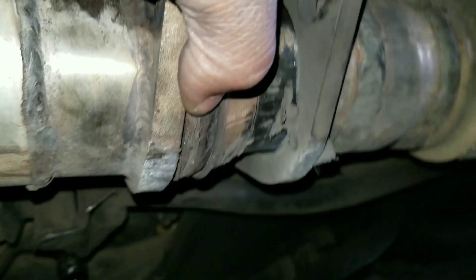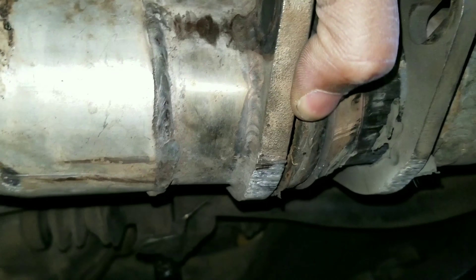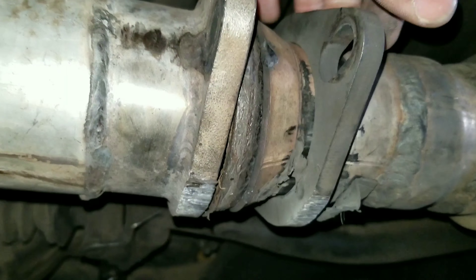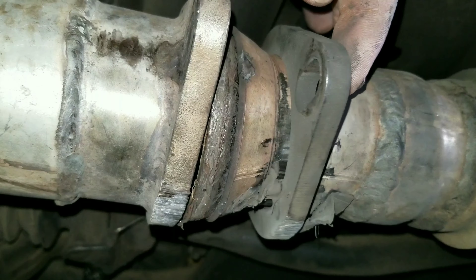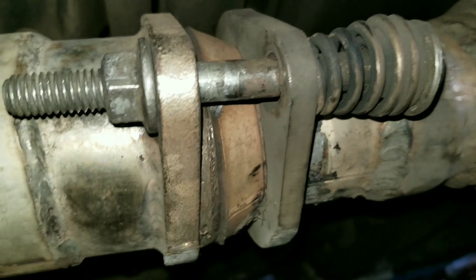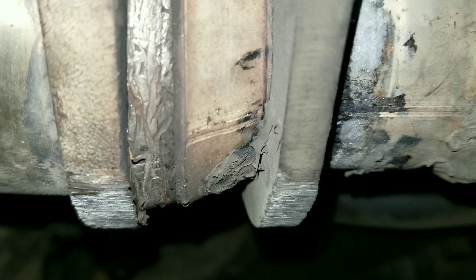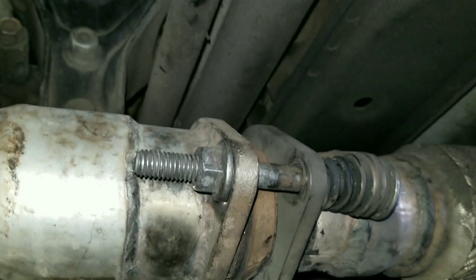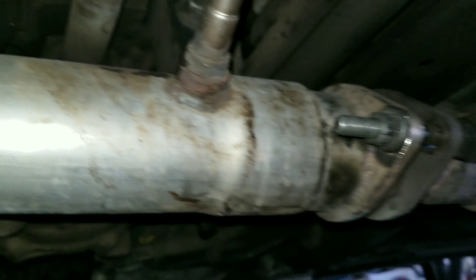As you can see, I already put it in there. You just put the flat part towards the engine and the round part towards the exhaust. I already got it in there. So let me put the bolts back through, and this time instead of the spring being in the middle, the spring is gonna go in the rear back here. Alright, we're all closed up — got the grommet, or whatever you want to call it, back in the center. Got the bolts all on, make sure they're tight. I'm gonna let y'all hear it right now so you can hear the difference between when the gap is closed and put back to stock, compared to how it was with the gap.